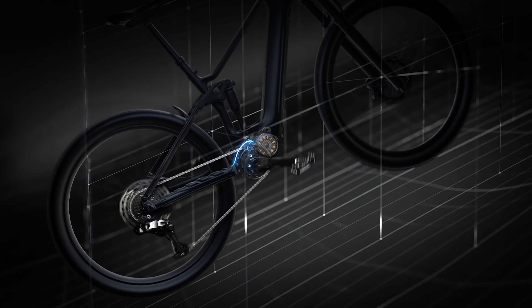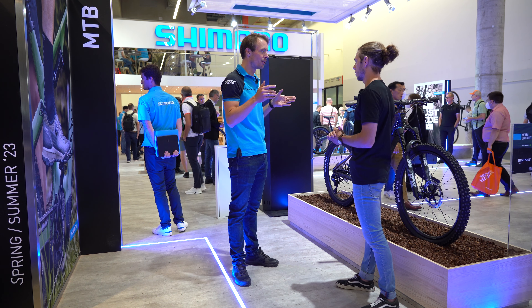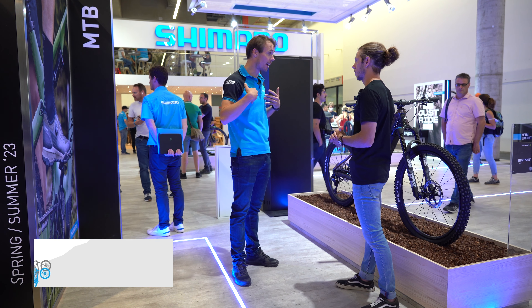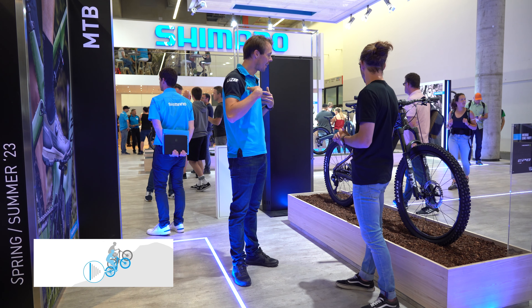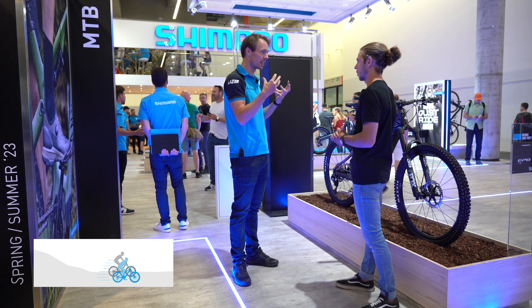It's super beneficial for a lot of riders. Free-shift is basically my favorite — it's pedal-free shifting. Normally you always have to pedal to make a shift happen, but thanks to our drive units — the new EP801, the new EP6, and Deore XT Di2 — we can allow for pedal-free shifting. Technically, the chainring moves independently of the cranks. So while you're on a downhill section going faster, the system notices that and shifts for you while you're not pedaling.